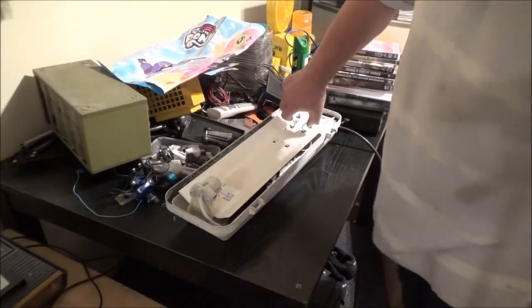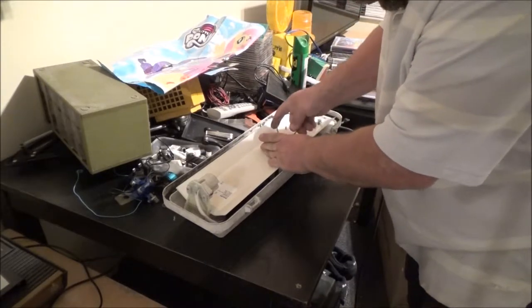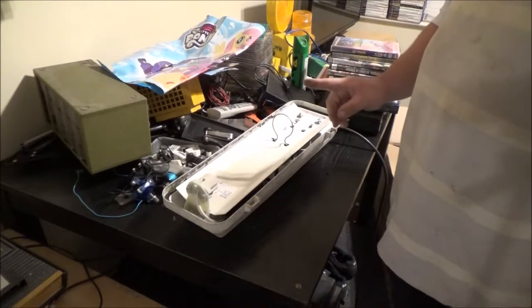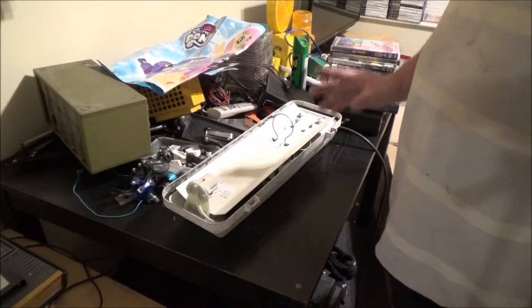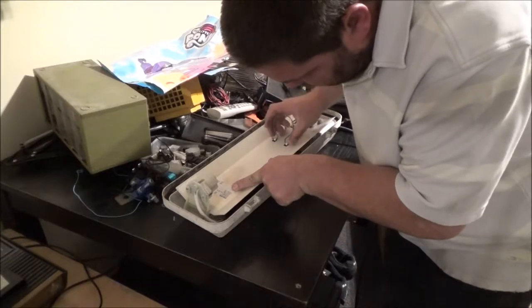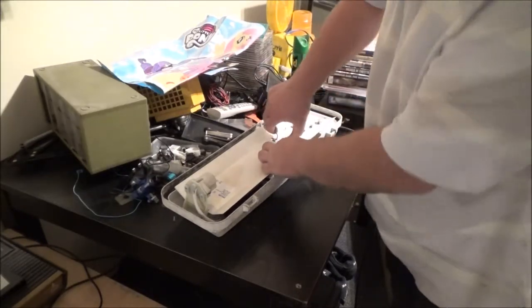I've noticed I can move this clamp down if I wanted to, and put it in this other position as well — it's got an adjustment on it. I don't know the purpose of that; maybe it's for different lengths of lamp. I've got a feeling that's what it is, because this is a 35 or 50 watt lamp. Looking at the label: 240 volt, 50 hertz, one times Sox, 36 watt. Oh, it is a 36 watt. I wonder why — I'm sure the advert said 55 watt as well.